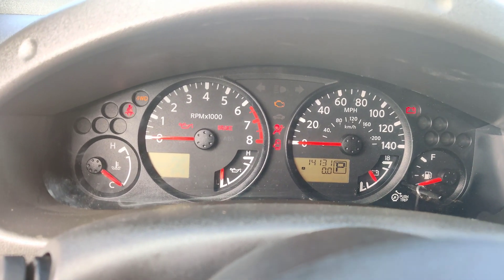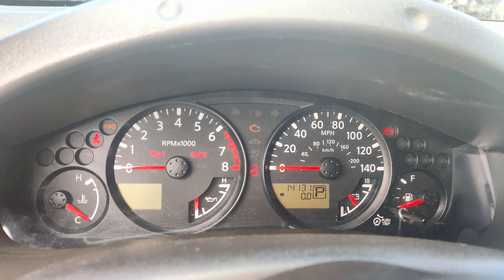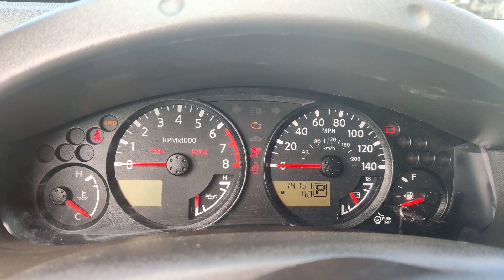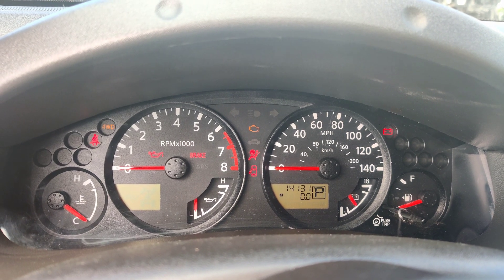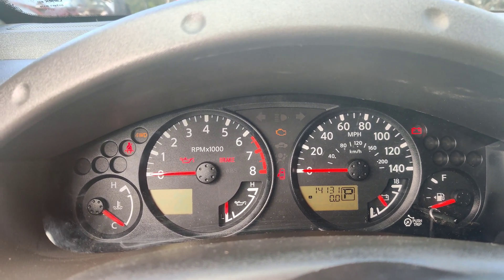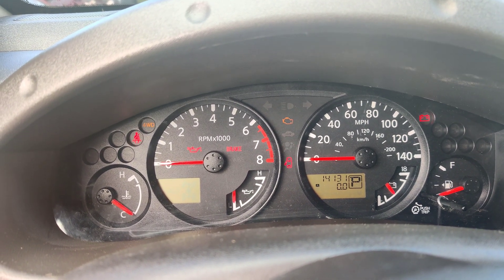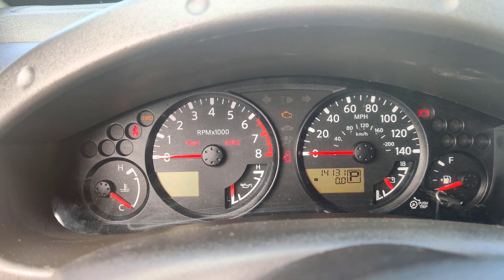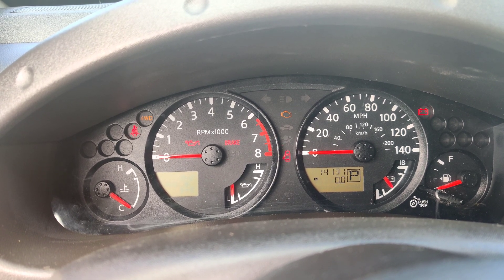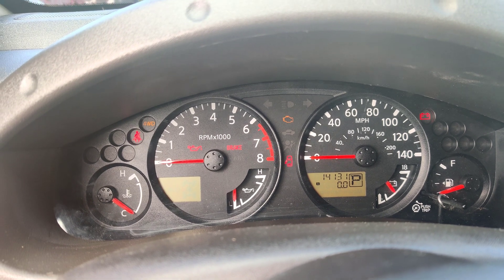We're back out with the Nissan. This airbag light turns on for seven seconds, then turns on again twice for about two seconds each, then it counts - I think five times. So this is like a hidden code Nissan has. You'll see it come up again - on for two seconds, off, on for two seconds, off. Then we count: one, two, three, four, five, six, seven. So it's a hidden code and it'll keep repeating.